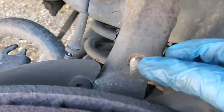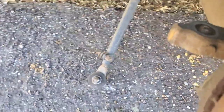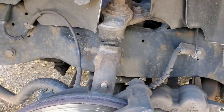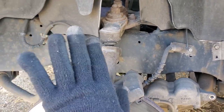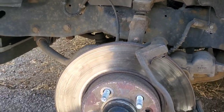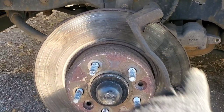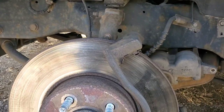I got the nut for the sway bar link removed and I also took out the tie rod end. And this thing — I'm pushing pretty hard with one hand and it doesn't even want to turn. I know new ball joints are kind of stiff, and older ball joints you can usually turn the knuckle a little easier, but I feel like these are worn out in a different way — like they have no lubrication whatsoever. It's extremely hard to turn this knuckle even with the tie rod off, so it's definitely good that we're going ahead and replacing these today.